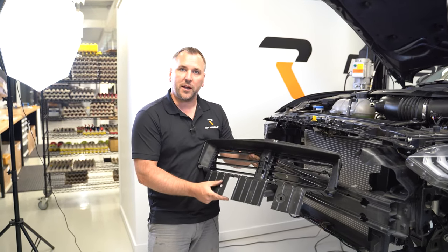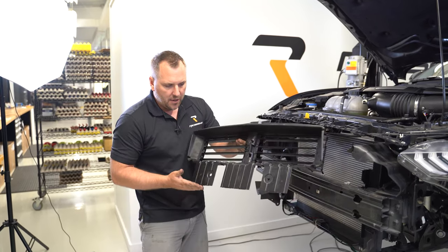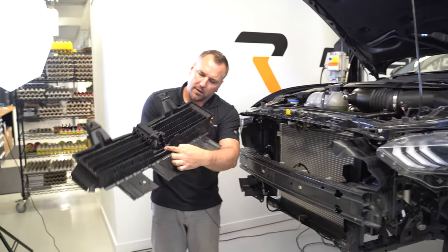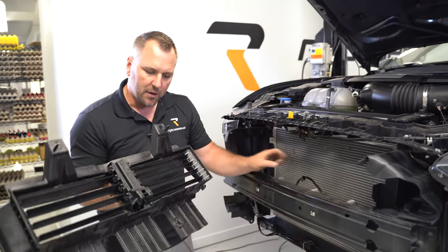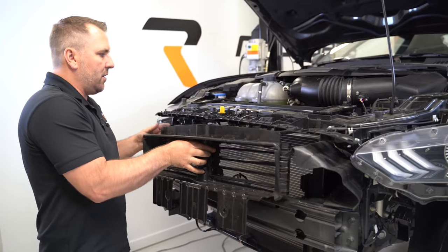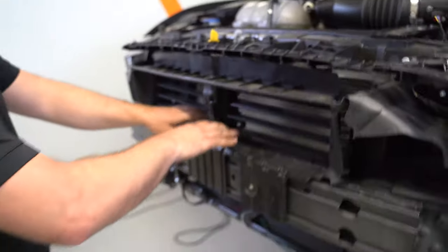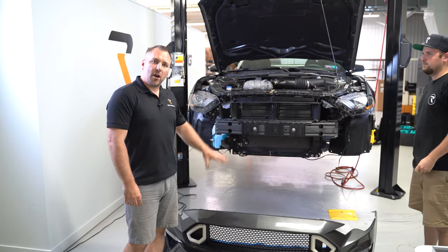The air vent is cut. We cut along the bottom edge so you retain your mounting positions to the front of the crash beam. Next, reinstall your wiring harness into the bottom of the air vent system and reinstall the wiring harness clip back into its location. Line up the top posts, reconnect your wiring harness, put the bolts in the front, and the air vent system is back on.